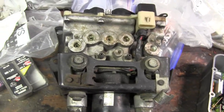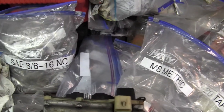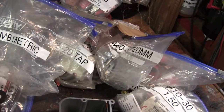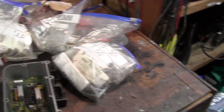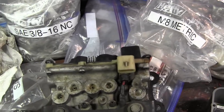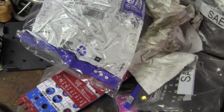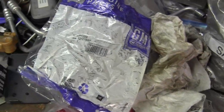I'm not going to drone on much longer. I have a lot to do today. I'm going to start with organizing my workspace here early in the morning, and I'm going to put probably one shim on the starter and then try to check it, because I'm not happy with how I've got the starter installed. I've got two shims and I'm going to put in one first and see if I can measure that 20 thousandths of an inch that's supposed to be there.